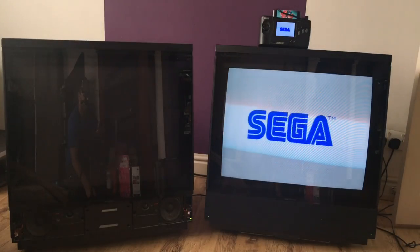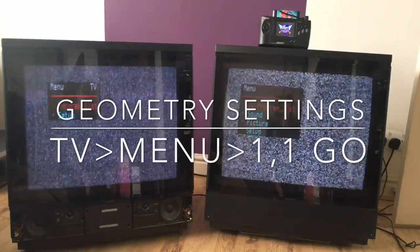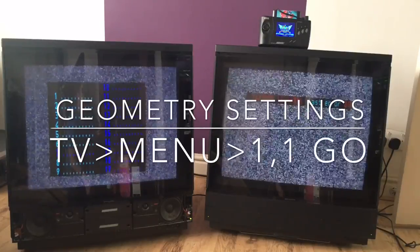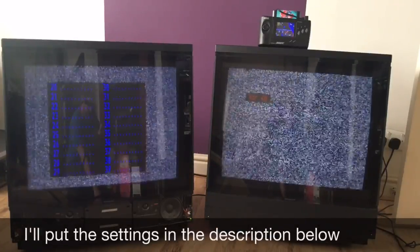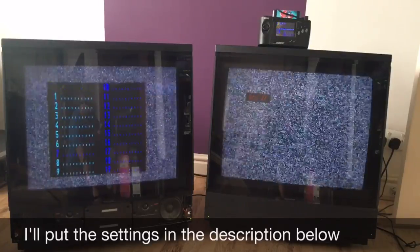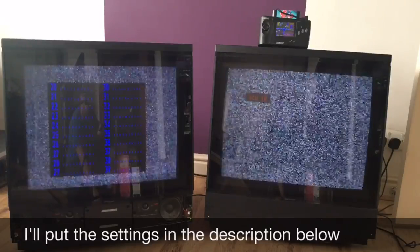Back to TV, snow screen, Menu 1, 1, Go. Now there is an error on this — I don't know what that is, Last Error 80. All the MX sets I've had, I've never seen an error code, so I need to look that up. RDR is set at 40. I'm going to change that to 36, 36, 36 and change that to 39. You can probably see the picture moving as I'm doing this — these are miles out, some of these settings.